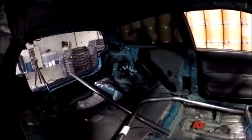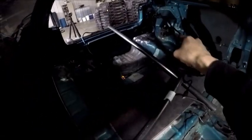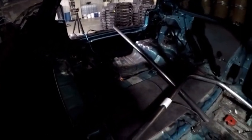So we're gonna call it a night. I actually gotta go to work right now. I'm already late. And basically just prepped everything, kind of cleaned up the surface here where it needs to be bolted. It's pretty dirty work, really. Get it all cleaned up. All the mounting points. We're probably gonna make it a 12 point instead of a 10 point because we got extra bars in plate. And then we're gonna put a crush bar in the middle here. And then that way we could go ahead and attach the parachute mounting points as well.